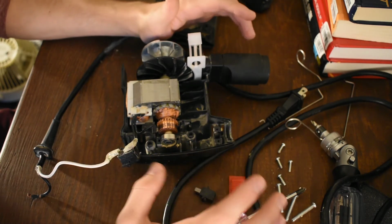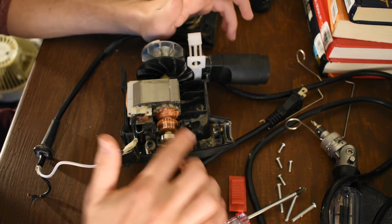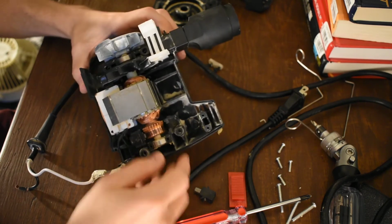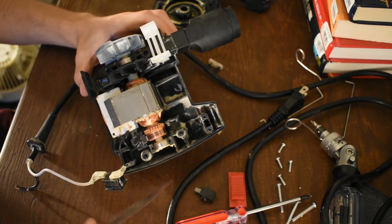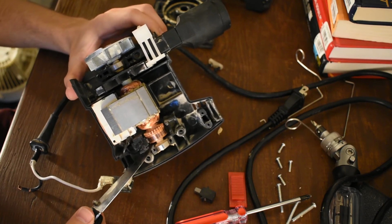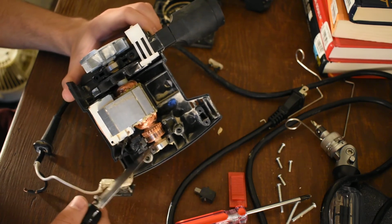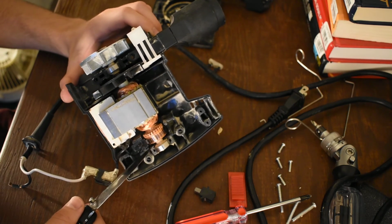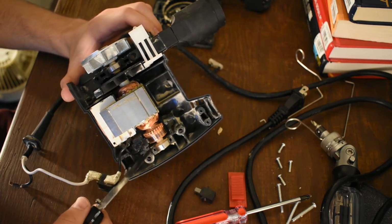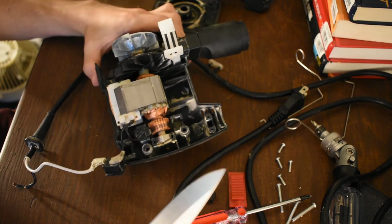I'm not saying sawdust is going to do the same thing. I don't know about that, but I do know it's going to burn. So if you're throwing sparks in here, look at this. The back of this bearing housing, in between the bearing housing and the commutator bars. When the camera died, I went outside and blew all the sawdust out that I could. It's still packed with sawdust in there, right next to the commutator bar. So it's gonna light on fire. It's gonna start a fire. It's not a good idea.